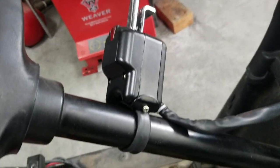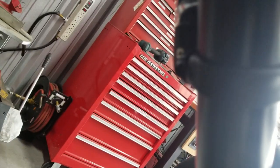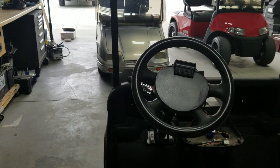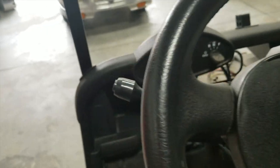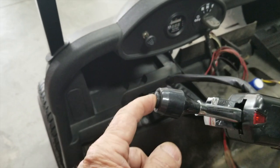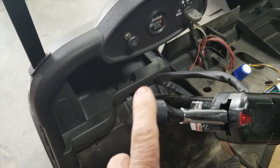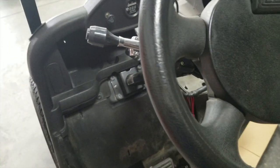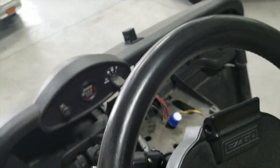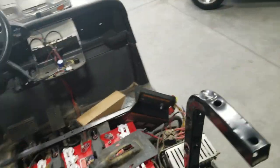I've got the turn signal assembly mounted — there's one screw on there, it's just a big hose clamp that holds these things on. Another thing: I always put these at an angle, pointed upward a little bit. That's for two reasons — one, a lot of people hit it with their knee when they climb in, and the horn button on the end breaks off. When this breaks, you're screwed — you can't replace just the button, you have to do the whole thing. I had somebody whose big dog jumped up in the golf cart, hit that, broke the horn off. So I always put this up at an angle on purpose.